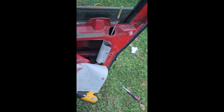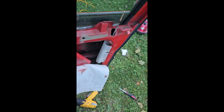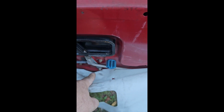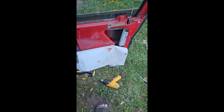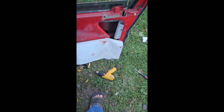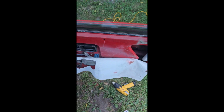And now is a great time to lubricate all of your door latch while you're already in here from the inside. Not many times you're going to be in here, so anywhere you have a joint, like right there and down there where it pivots, you should lubricate that. Anything, you're not seeing much, but anything in there that moves, lubricate it. It's a great time now. You can use white lithium, you can use a graphite spray, a dry graphite, or even just WD would be helpful.